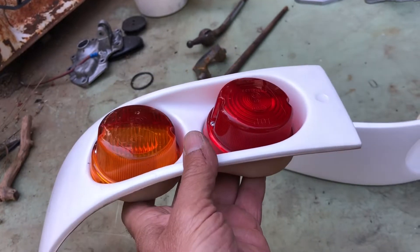I'm going to take the harness and make it work over here. Here are the critical bits: once I disconnect it, the black with silver striping goes down to the single bulb turn signal. This beige wire — as most Porsche stuff is — is a ground that goes back in the ground loop. The gray with a brown stripe is reverse — the reverse light, which there's no provision for here but we'll come up with something. The thick black with a green stripe is the brake light. The whitish-gray with a red stripe is the running tail lamp, which we'll also use.